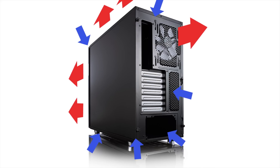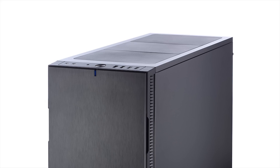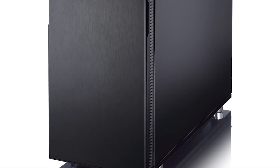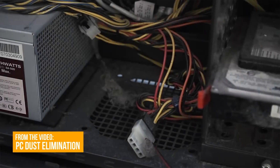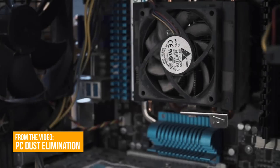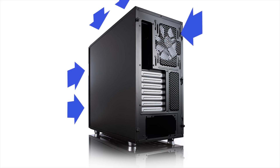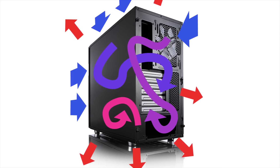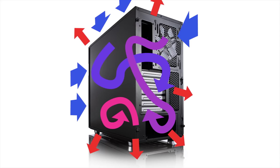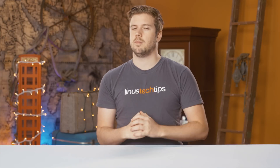The conventional wisdom goes like so. A negative pressure setup will end up pulling air into the case through small gaps in the chassis that are just unavoidable, unless case manufacturers used some type of seal everywhere that two different parts of the case met — like your side panels to the case, for instance. This would completely destroy the usability of the case. Because of air flowing through these inevitable gaps, dust is also sucked in and accumulates throughout your rig, potentially reducing cooling performance or even causing component failure if left long enough. Easy solution, right? With a positive air pressure setup, you'll be pushing air out of those cracks instead. But if you overdo your positivity, it's going to be really turbulent inside the case. You might end up creating pockets of hot air that actually harm your cooling efficiency. And besides, no cases that I'm aware of are designed to have an intake on every single fan mount, so perhaps the more balanced approach is the answer.